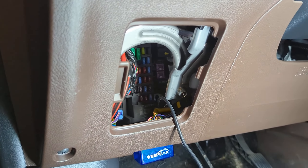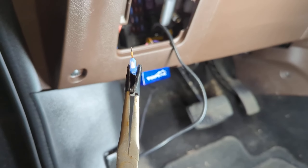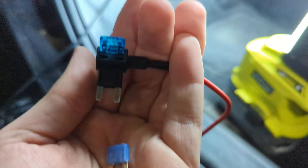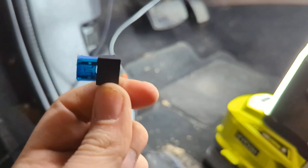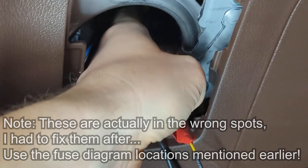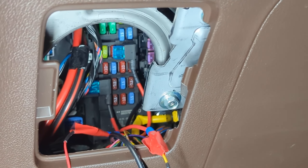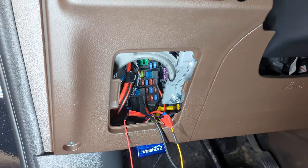I was able to reach in there and pull one out. I had to use these really long pliers, and I've wrapped the tips in electrical tape — you don't want to be shoving bare metal prongs into your fuse box, that's a big no-no. I've got it out, I'm going to take the fuse and just stick it in those two slots. Now I'm just going to reinsert this into the fuse box. I got them in there — it was a huge pain because it's so deep that you can't get it done without really long needle nose pliers. Most vehicles don't have it sunken in that deep; normally they're almost flush with the panel.